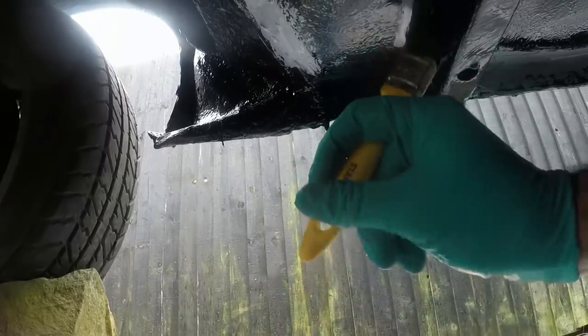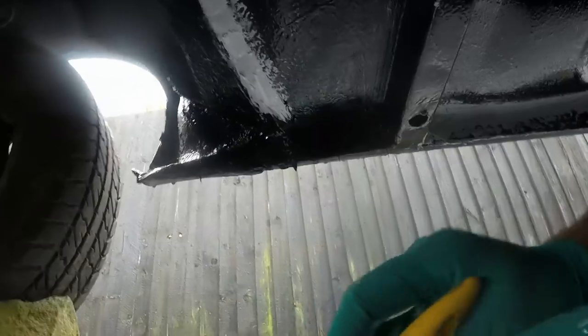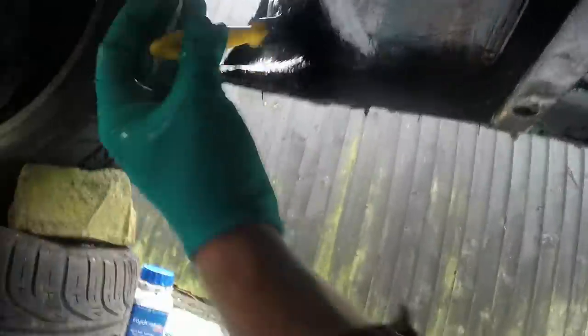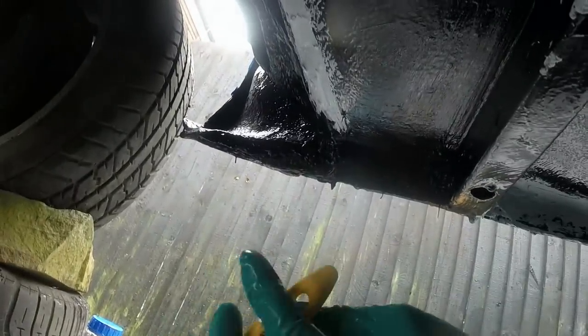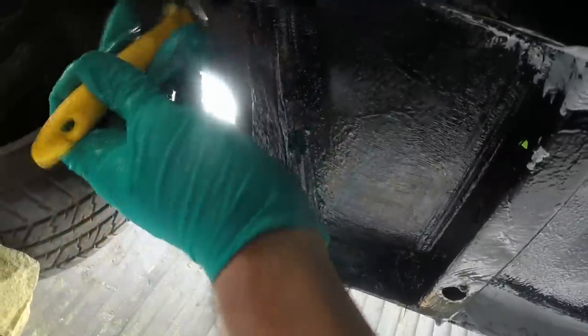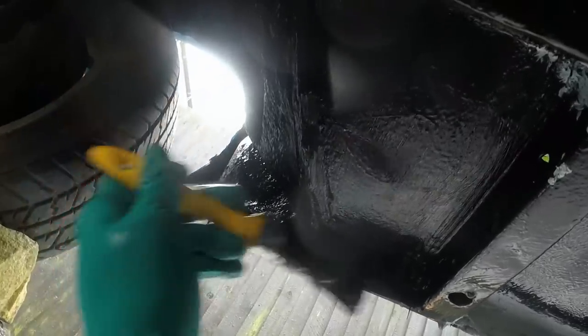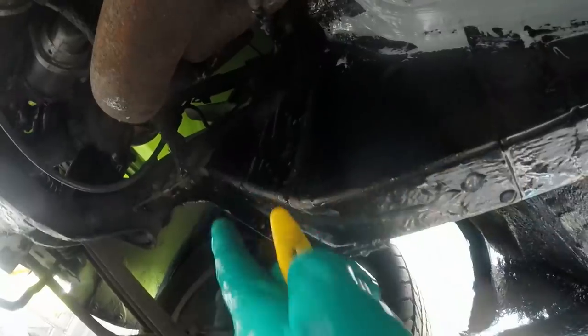I thought I'd do a little test area just to make sure this stuff works — it says on the can it'll go over pretty much everything. Most of the Upol stuff I've used has been really good like that. I'm going to put it on fairly thick and then as it's going off I'll go back over it with a roller. You can see why I stipple-finished the Jotun last time — I wanted to end up with a finish this could bite into. I'll continue doing this, hopefully not catch pneumonia, and hopefully report back with a lovely sealed underbelly. I did actually paint up inside the engine bay as far as I could get, but it really wants the engine out and masking done properly — I just don't have the time.